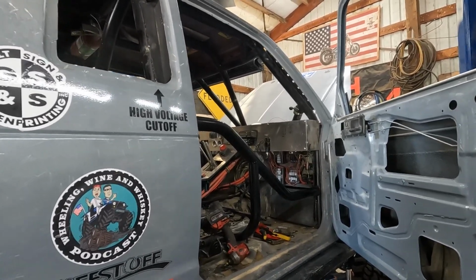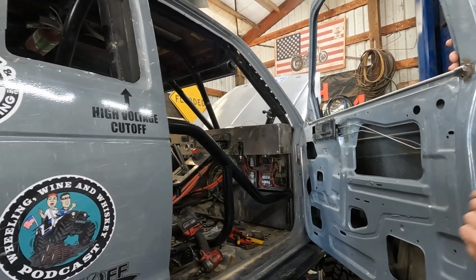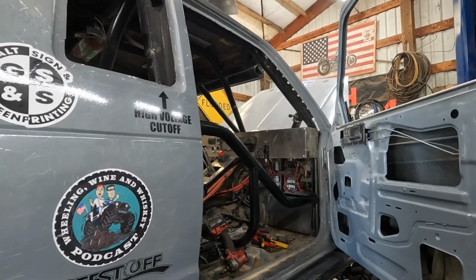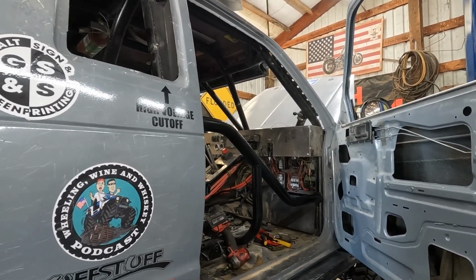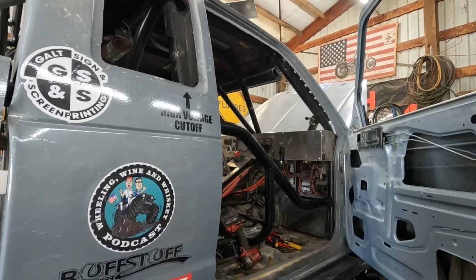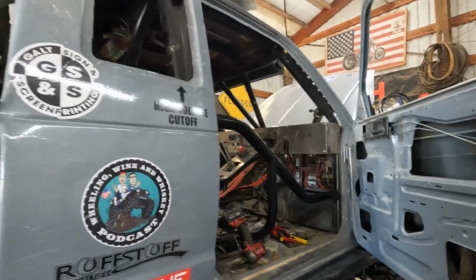No, you wouldn't. And then we got the high voltage wiring is all shielded already, but we're still getting a little bleed through it. So now we're going to shield all that and shield the CAN bus. So that way both systems are shielded even more. And then on her side, there'll be a navigation here and a handle here for her. It's all taken apart right now. She has her little GPS screen she looks at all day. Cool. So that's part of that fun.